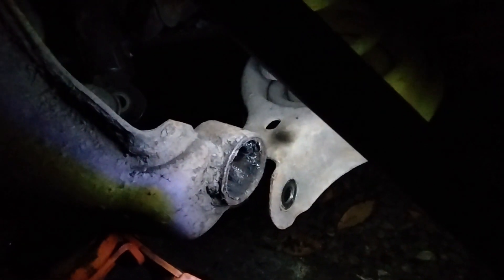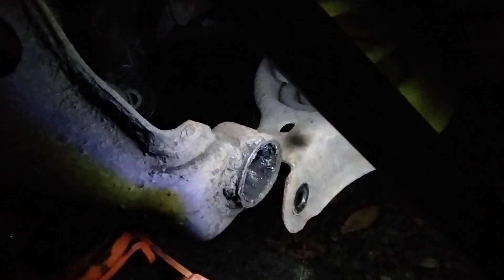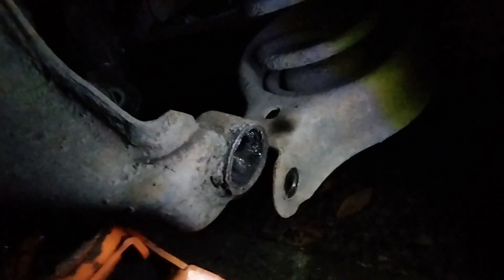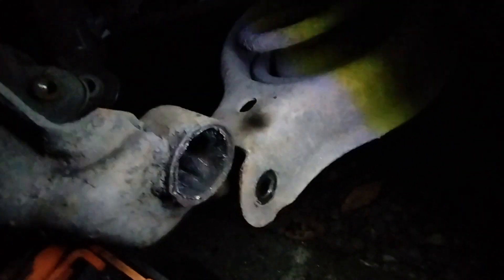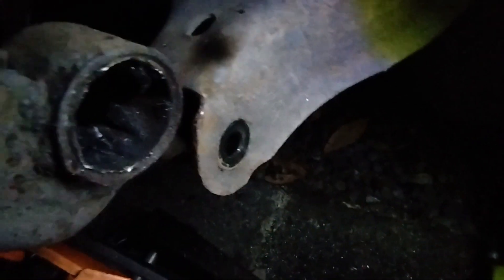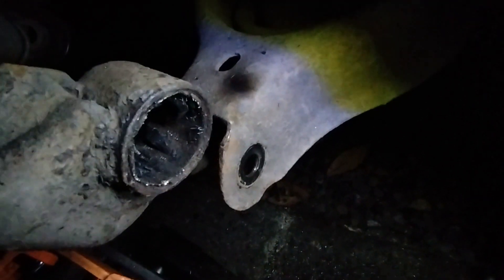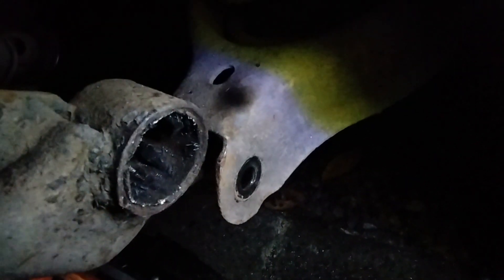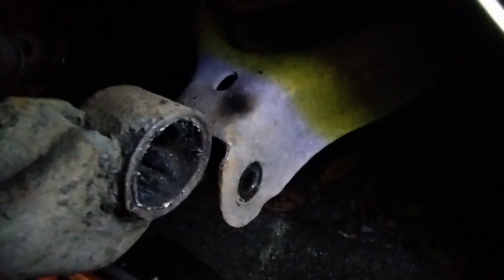It's out. After drilling around the bush and then burning the hell out of it, it dropped out. So now we need to get this hole cleaned up. We need to get the inner race off by the looks of it — you can see that metal lip there, we've got to get that off first. I should be able to twang that out, so that's what I'm going to do now.